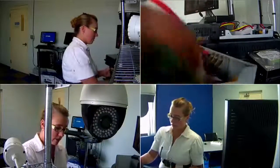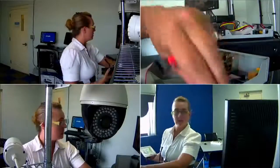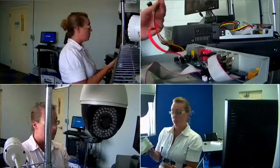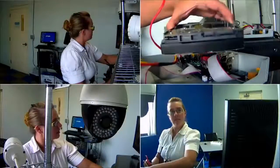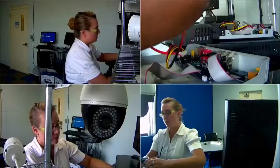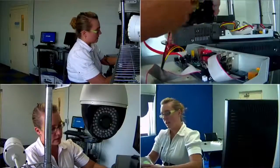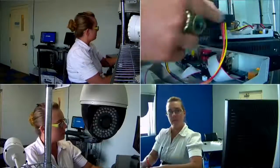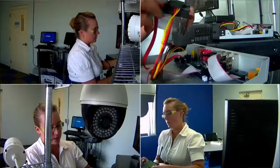When you install a hard drive you want the DVR to be unplugged and off. You're going to take these two cables and install them into the hard drive in the only place where they fit. The side of the hard drive is grooved in such a way that it will only fit one way — I cannot install it incorrectly because it won't fit. The same applies to the data cable; it's grooved so you can only install it the correct way.